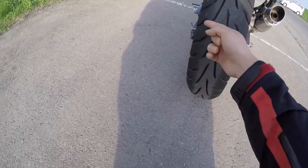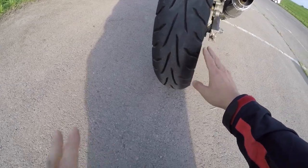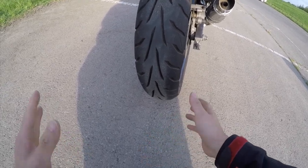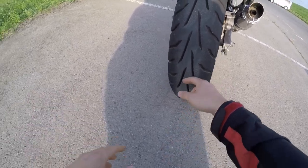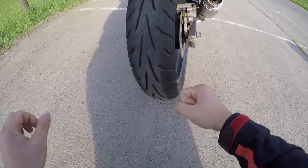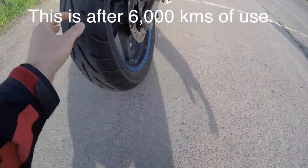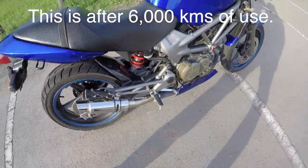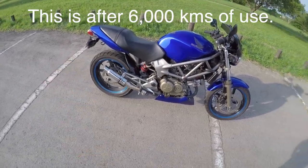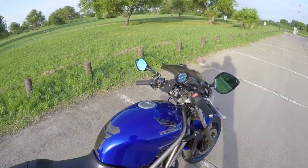once the old tires were squared off quite a bit, but once I put the new tires on, I found that I could lean into the curves much easier, and there was just all-round stability because they weren't squared off. There was enough roundness, so when I leaned over, it was just like this equal grip all the way around. It's quite decent in wet weather as well, and I quite like them. The price is good. And I don't know how long the rear tire will last, but the front tire has gone about 17,500.